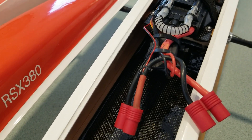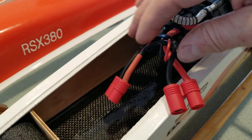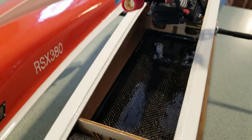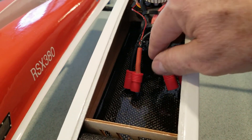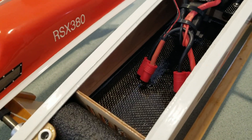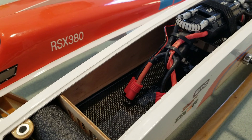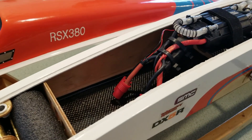I have it on the series side so it reads the combined voltage of both packs — that's what I want to know when I stop to check my volts while running. Nice tidy setup. I have pretty much a cave under there where I can put whatever batteries I want. I'm going to lock them in there with foam — no straps, just sitting right down on the bottom. That's how you get your biggest lipos in terms of milliamp hours into these riggers.